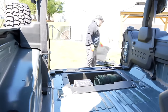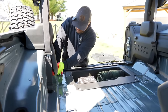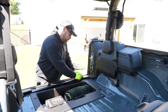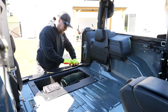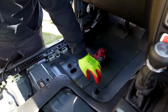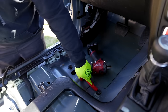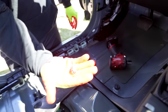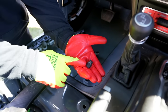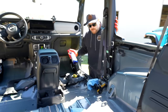That's really easy to get removed. The thing we have to be considerate of is we're going to have to get the Armor Light under here. One big crucial step: you do have to remove both of these 16mm nuts. They're on threaded posts here and these are your factory carpeting. Grab a 16mm socket and yank these off. The threaded post - there's a little thread there sticking up. That can stay, you don't need to cut it off. It's just this section you need to remove. The Armor Light flooring is designed to work with that threaded standoff that is there, but these nuts have to be removed.